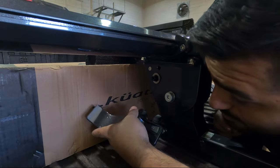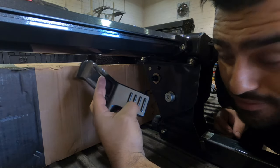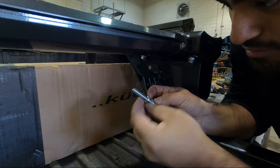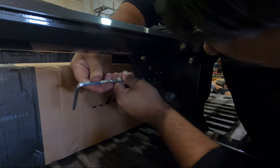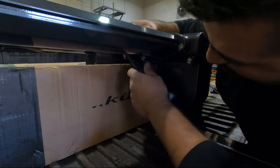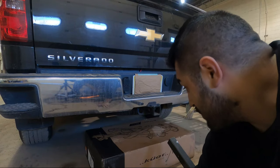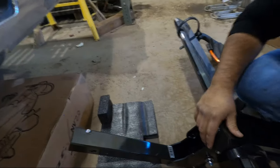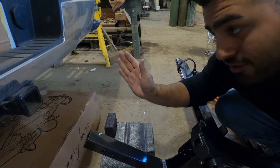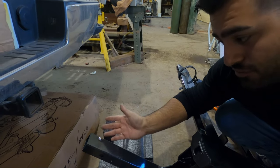This is as simple as it looks. Pretty much all you have to do is make sure the rib side — this side right here — is facing towards the front of the rack. Take your lock washer and your screw, screw it in, and you're good to go. It will actuate as you can see. Next we're actually gonna put this thing on the hitch. Before we install it, I want you to take a look at this ball — pretty much what it does is it pushes up against your hitch and eliminates all the moving and swaying back and forth that most racks usually have.